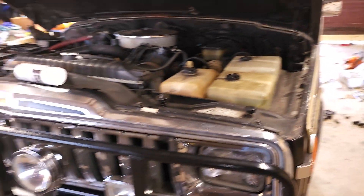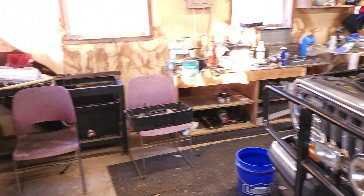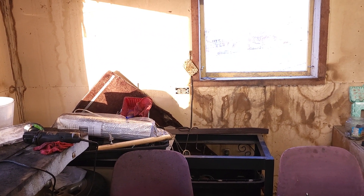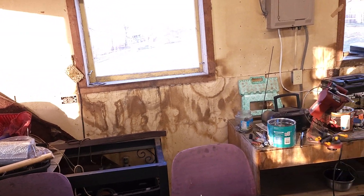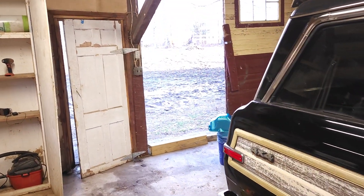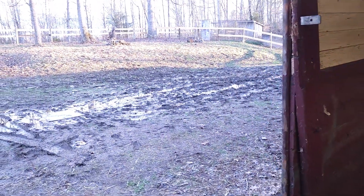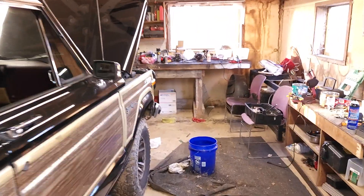I really don't want to use that cork gasket because cork gets hard as a rock after a year or two. When you take off the oil pan it's basically like glass, as you saw in my prior video. As much as people say cork is better than RTV because RTV can break off and get into the pickup tube — well, when I did the oil pan a few years ago, the original cork gasket had squished out and broke into about 50 pieces in the pan, and 70% of my pickup tube was completely blocked with cork. Unfortunately, they don't make a one-piece gasket for the 360; they make them for the 4-liter but not the 360. So we'll go cork, and if it leaks I'll throw that crap away and do RTV, which is kind of what I think I should be doing to begin with.